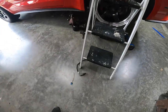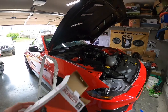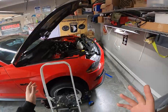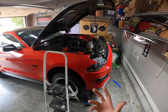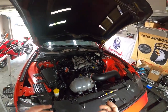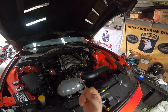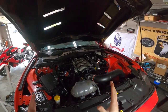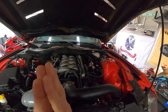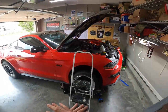Now let's move on to the Mustang. There's a wastegate and a bunch of stuff down there. We had like six check engine lights the other day — pretty crazy. For everybody that is new, this is a twin turbo car that performs very well and is capable of quite a lot. We also have a Lethal Performance fuel system for E85 so we can get all that power with safe fueling. Something I've been keeping off the channel — because I didn't want to highlight something bad without knowing a fix — is that we've been fighting fuel trim issues. Short term I've gotten that down, but long-term fuel trims have been a horrendous problem.